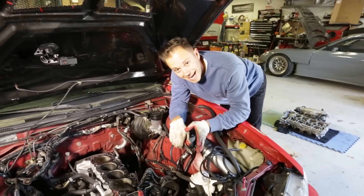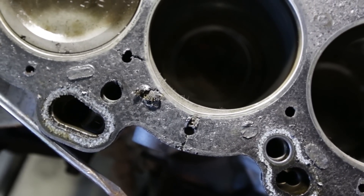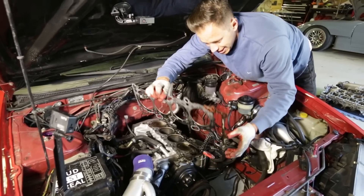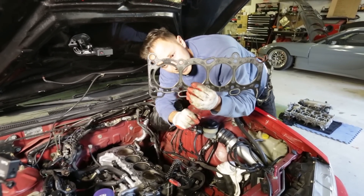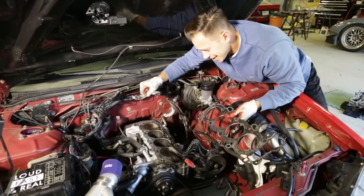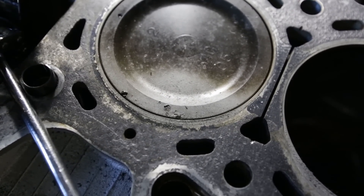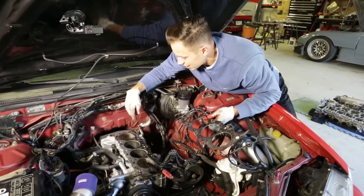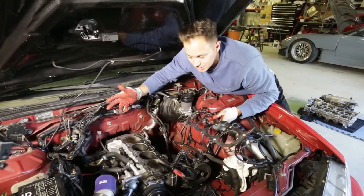It's obvious where we had the head gasket failure — right on the second cylinder. It actually deformed the head gasket metal lining. Even on the fourth cylinder there was a little bit of seepage. The puzzling part is it looks like somebody dropped some metal into the combustion chamber and there's some damage on the pistons. I've seen detonation before and it usually doesn't look like this, so I'm going to ask a couple of friends who are more knowledgeable to figure out whether we've got an issue with this piston damage, or if it's just something from a previous head.